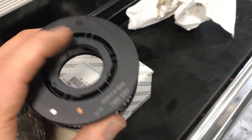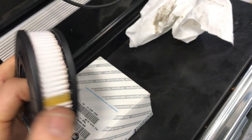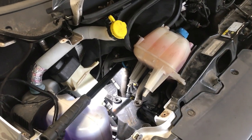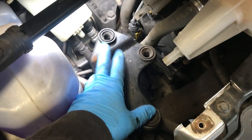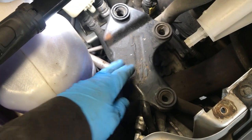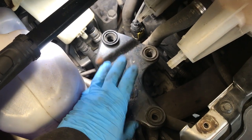I'm going to take that filter out, see how it looks, and just put a new filter in there. To get to that Crankcase Ventilation Filter, I need to take the headlight assembly off and move this bottle away, because it sits right on this stupid bracket. I was going to take the bracket off, but there are a couple bolts on the bottom which are really hard to get to, so I'm going to try to leave it on.